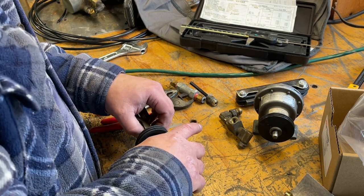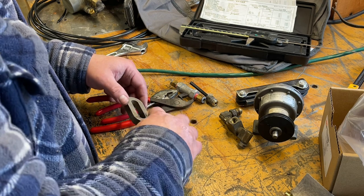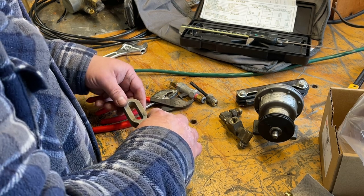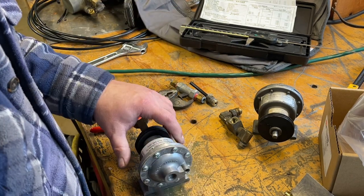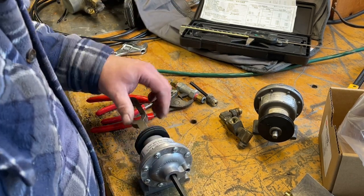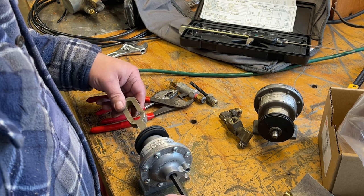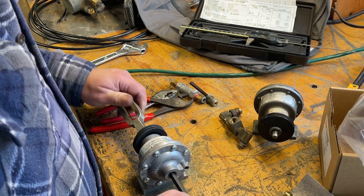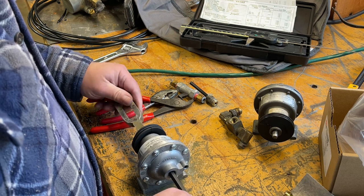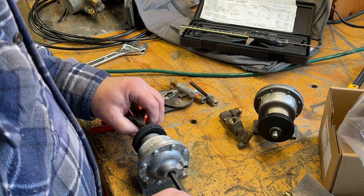And then it's got to rotate to be aligned correctly, right? So, this is where I need the Allen wrench, I guess, but I do not want to make this overly tight because that'll strip the threads out. Yeah, I mean, that's literally it. Those threads are bottomed out right there. So you don't want to do that. I'm just going to back it off a little bit there.